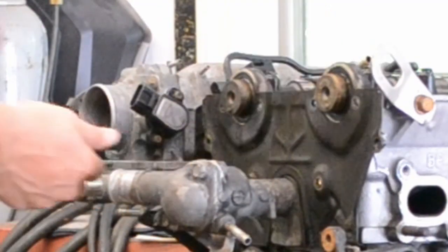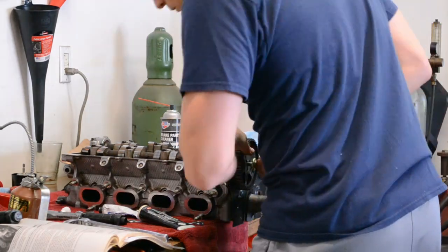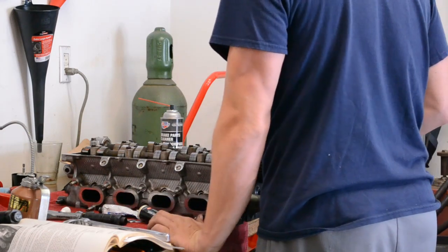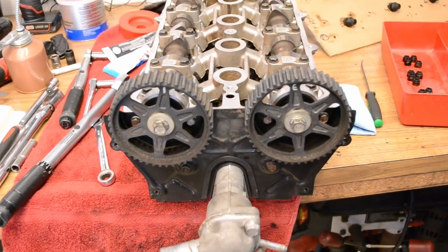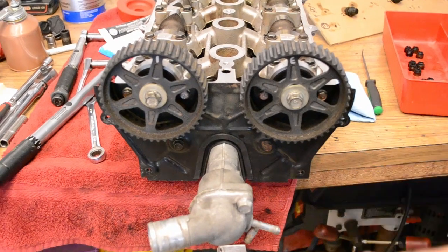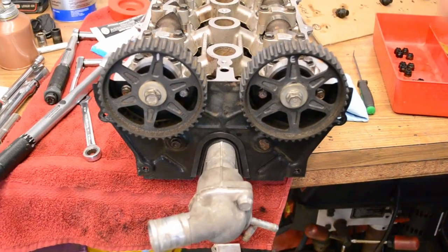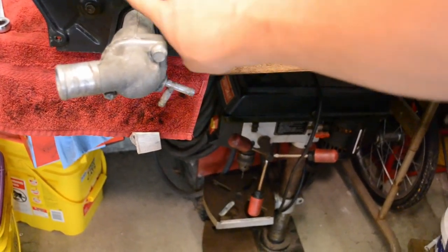The backing plate goes on next, and again my camera was dead, so I apologize — I've just reversed the disassembly video for you. Your gasket kit should have a fresh U-gasket that goes over the thermostat neck on that backing plate, so be sure to switch that out if yours is bad. With the plate installed, we can move on to the timing gears. The intake and exhaust cam gears are interchangeable — I marked mine with I and E to keep track. There's a little dowel under each gear that keeps the gear aligned. You put those dowels at 12 o'clock or top center, then put the appropriate gear on each one, and the E will align with the timing marks.